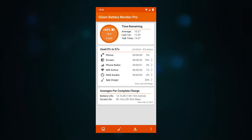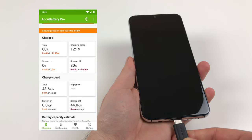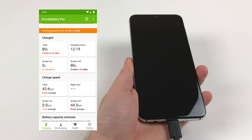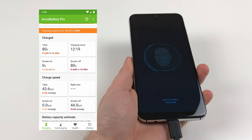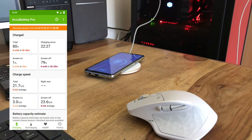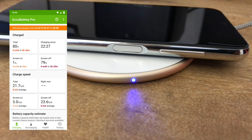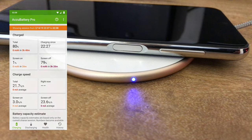Battery is where things look better again. The 4150mAh battery provides a good battery life of 1.5 to 2 days depending on usage intensity. Charging by wire takes 1 hour and 49 minutes from 22%. The phone also supports 15W Qi wireless fast charging; tested with a 10W Qi charger it resulted in a charging time of 3 hours and 40 minutes.